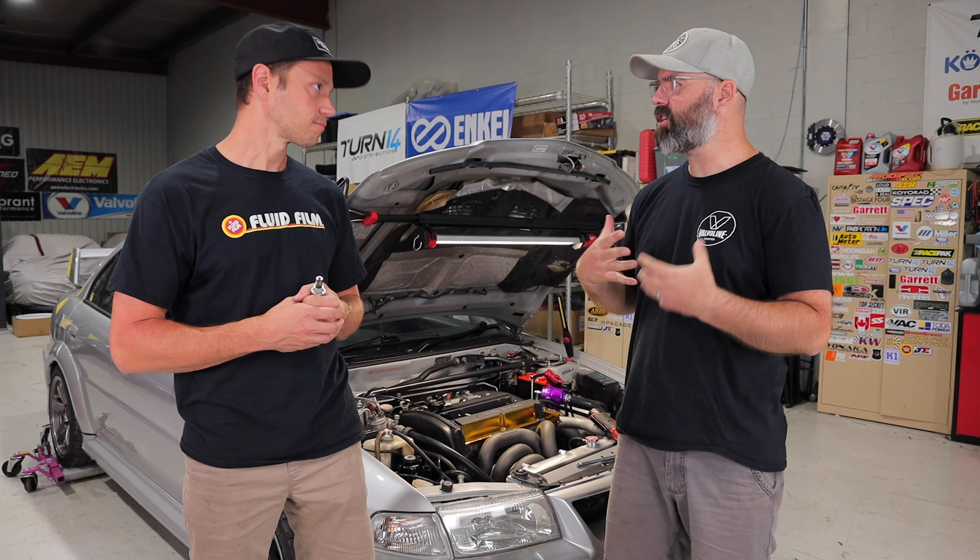Time-wise, we're always rushing here with a tough schedule to keep up with for YouTube. I've been considering — why don't we just turn to MA Performance? They have short blocks and long blocks you can buy from them, and that might be a quick remove-and-replace so we can get this Evo vs. STI battle done, versus having to tear this whole thing apart. If we need a new block, it's even more tempting to just go that way because of time. I'd love to rebuild it and make it run well eventually — maybe not in this car, maybe in another car — but I'd personally love to get to the bottom of it just for the satisfaction of knowing we can build a motor that'll stay together. We just need to do the right things, which probably include decking the head and block.